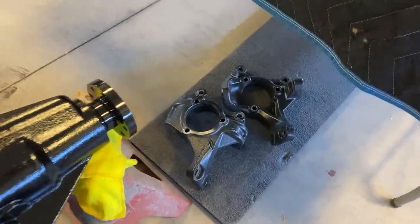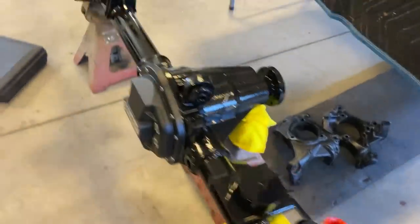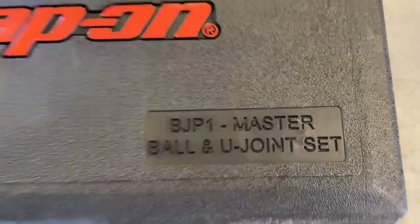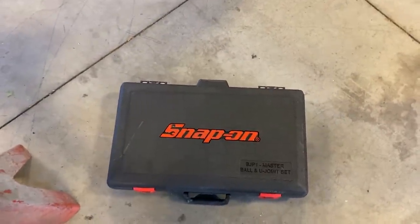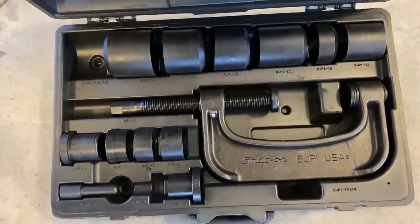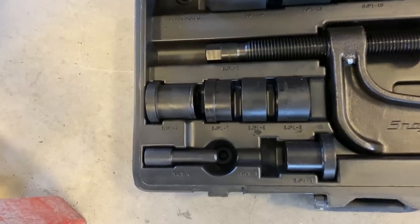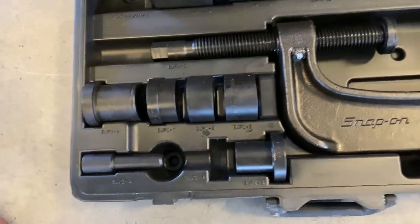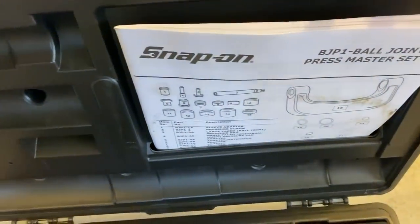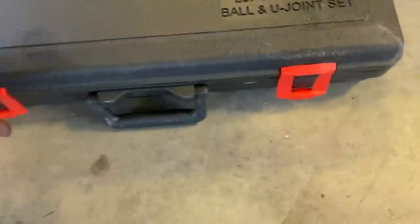We got all of them in on both sides. Got the old knuckles off — they're the Teraflex upgraded knuckles, so those are going to go on here once we get the axle in the JK. I put those in with the Snap-on Master Ball Joint and U-joint set — this thing is awesome. I am not sponsored by Snap-on in any way, shape, or form, but that thing is awesome. It'll do ball joints, it'll help you do U-joints — this little cup pushes on one side and the other end pushes a cup out. There's your instructions — yeah, I kept them.